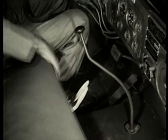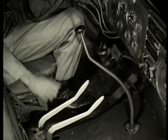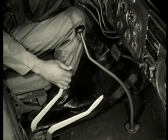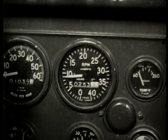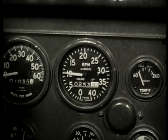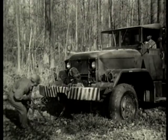In the driver's cab, shift the transfer case to neutral, shift the transmission to neutral, and shift the winch control lever to reverse to pay out the cable. Using the throttle lockout, regulate the engine at a steady speed not to exceed 1,000 RPM. The cable is then paid out under power.